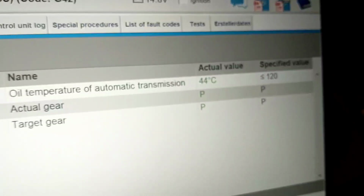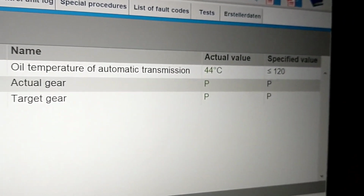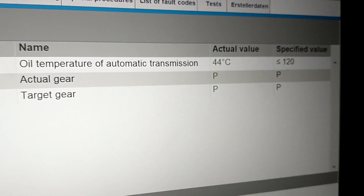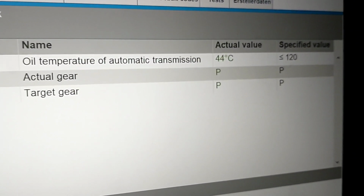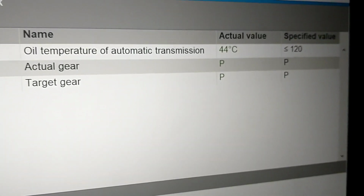So as you can see there, the drain plug gives us about almost exactly the value we want. It's close. The spec's 40 to 45C, which is like 104 to 112 or something Fahrenheit. After doing that even, we're still at 44C. So really, if you got a good temp gun that was even reasonably calibrated and got yourself to about 105 at the drain plug, that should put you about dead center of the spectrum.